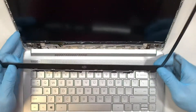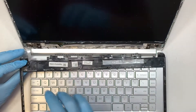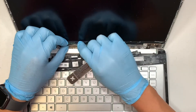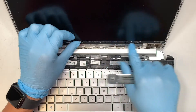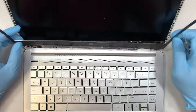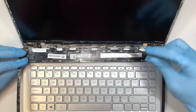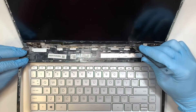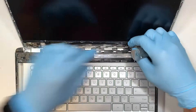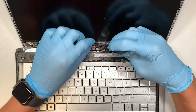So we finally removed the entire bezel. Let me recap what happened. The screen itself has a black protective layer — somewhat like aluminum foil — underneath. When you separate the bezel, try to separate the white adhesive away from that black plastic, because sometimes since they are stuck together, you may actually be separating the LCD screen plastic.